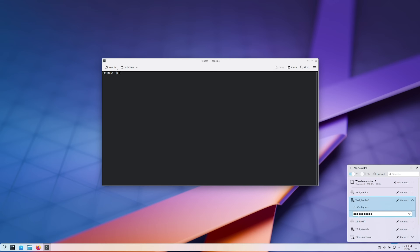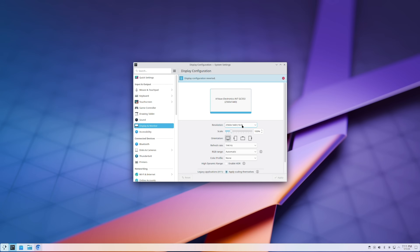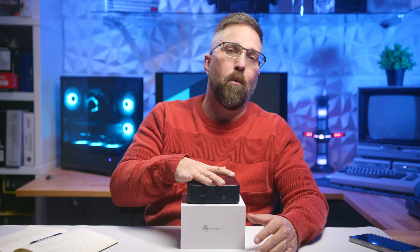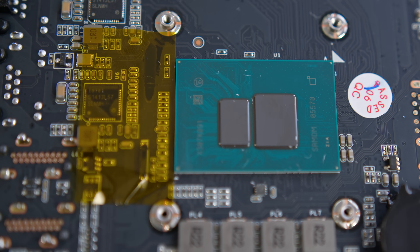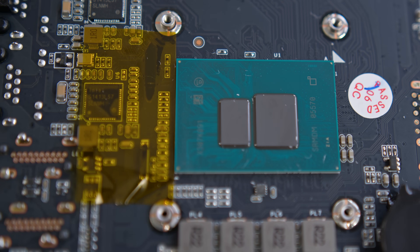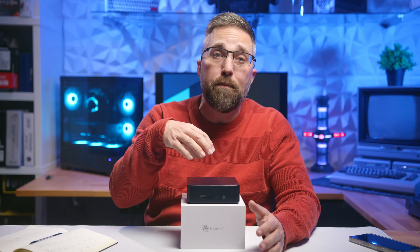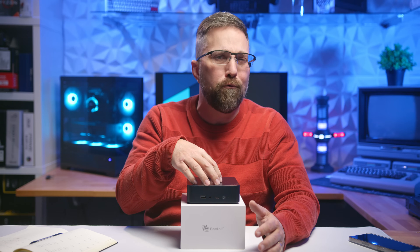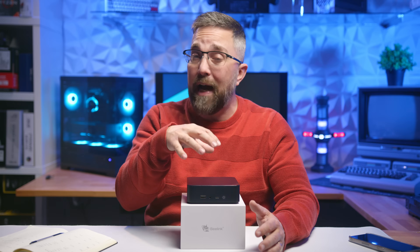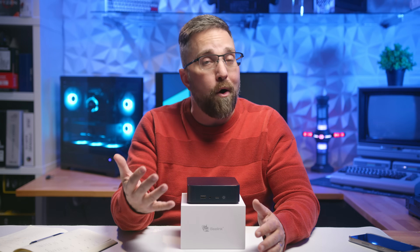With each system up and running, I start by testing all the hardware: Wi-Fi, Bluetooth, display drivers, Ethernet, expansion ports, and audio input and output — making sure everything works as expected. The most notable potential concern is the N150 processor itself. It's technically a new architecture, and it officially releases tomorrow, so there's a chance some updates might still be needed — like tweaks to the kernel schedulers, power management, or frequency scaling. If there were architectural changes to the iGPU, updates to the kernel's direct rendering manager or the Mesa 3D graphics library might also be required.